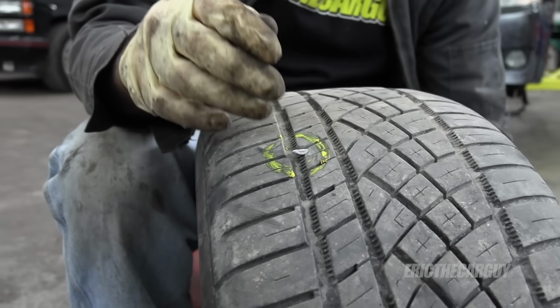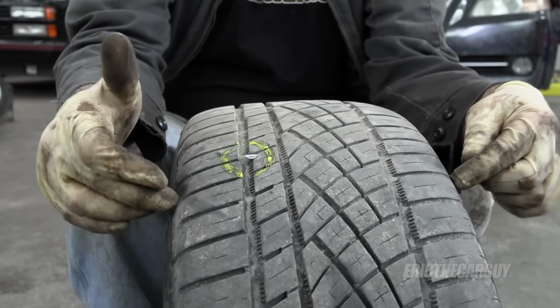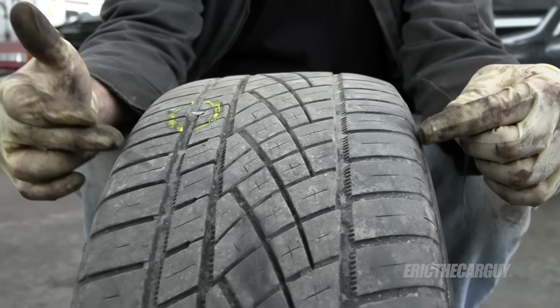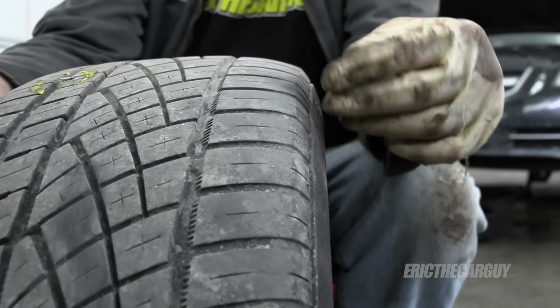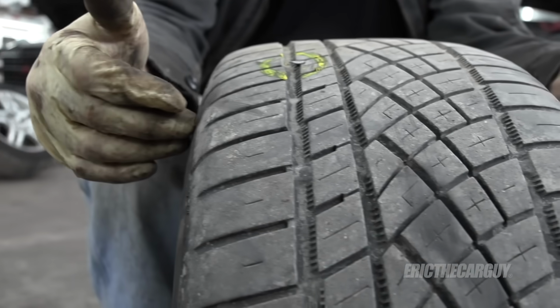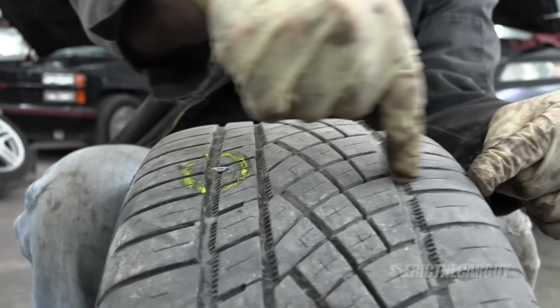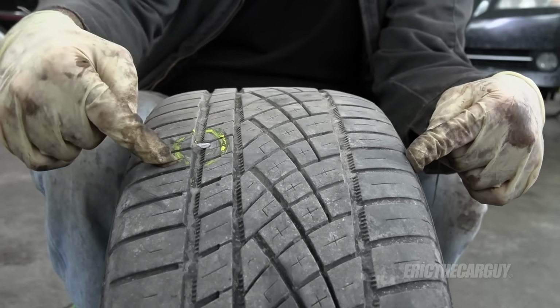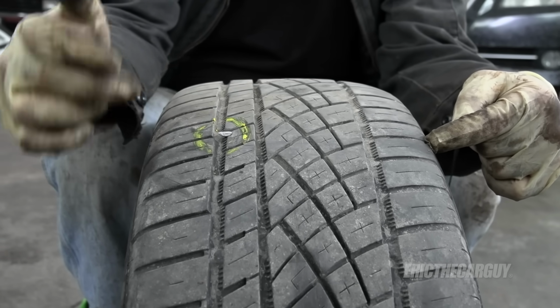But here's something very important with any kind of tire plugging, even with what I showed you. You cannot plug into the sidewall at all. In fact, anything from where this sharp bend goes down is considered out of limits, out of bounds. So the only place that you can install a plug is pretty much across the flat of the tread here. This is well within that area, so it's perfectly acceptable to do a repair on this tire.